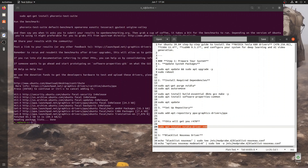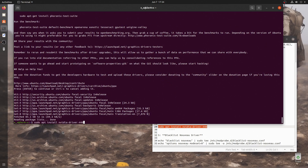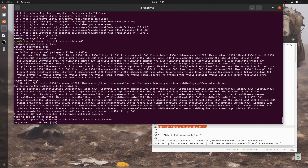This is the trick. All other guides and NVIDIA lead you to the R470 drivers, but with the K80 we need the Kepler-based driver. While loading the 440 driver you will see that it is actually installing the 470 driver.